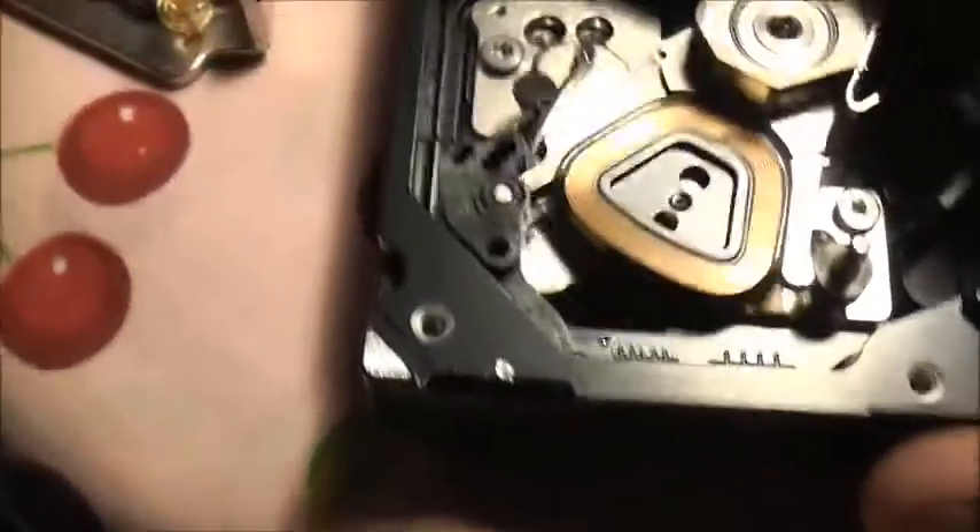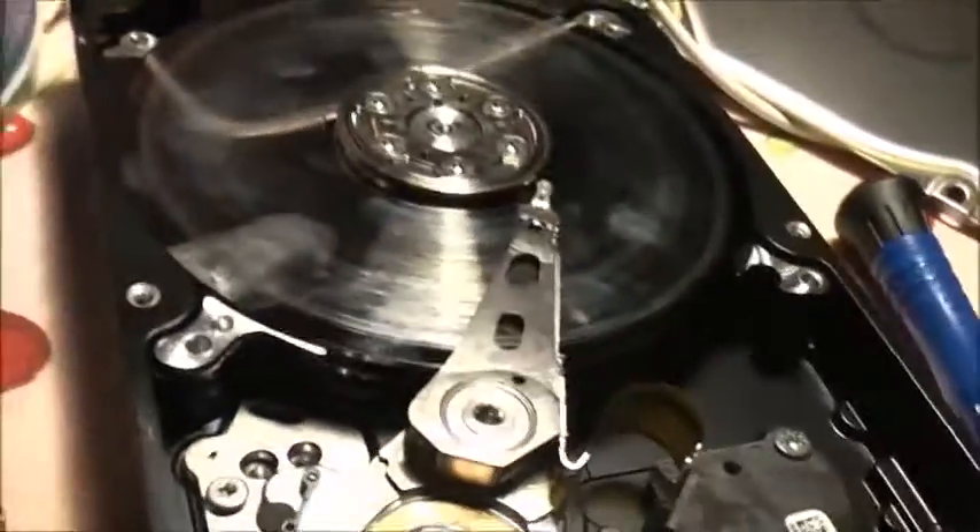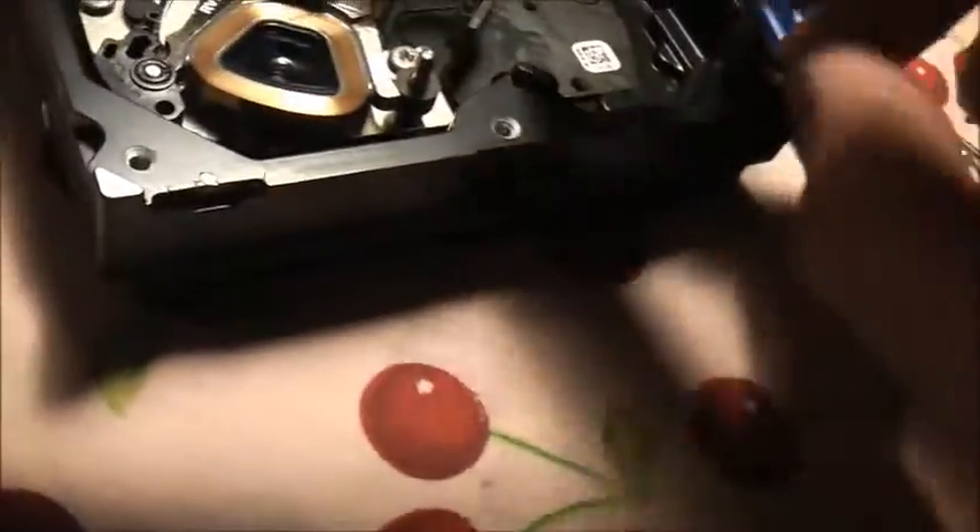If you ever use these drives, you'll hear a nice clunk from moving there. That's this little plastic bit coming from the computer - it was this thing. Because I originally thought this drive had a click of death or a start-and-fail when I first bought it, so I did some checks, rang the shop, and they were saying the clicking and clunking is natural on these drives. I can see why now - it's this little thing here as it parks the head.